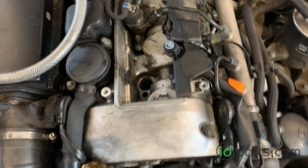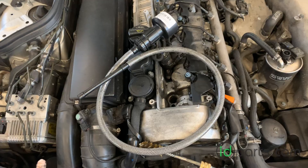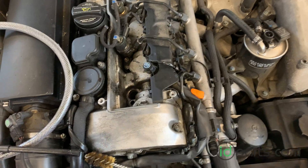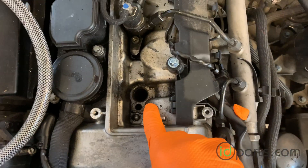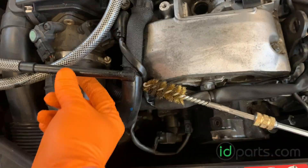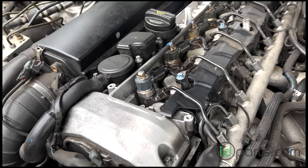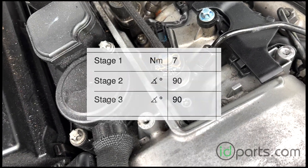After cleaning, I use a shop vac extension adapter — full-size shop vac on one end, a very small straw on the other — that can go all the way down the bore to collect any remaining pieces the brush knocked free but didn't remove. You want the bottom of the bore to be super clean and you don't want any debris sitting in the cylinder. Once the injector bores and the hold-down bolt threads are clean, it's time to reassemble. The torque for the injector hold-down bolt is a three-stage process: torque to 7 Newton-meters, then a 90-degree turn, then a final 90-degree turn.